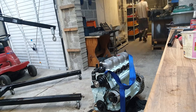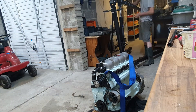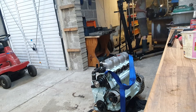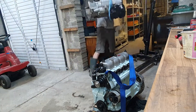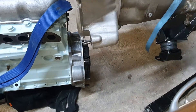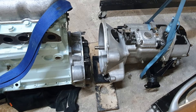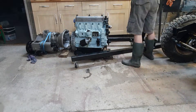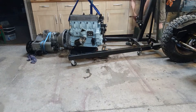The engine is now on the floor, protected on top of a cloth so as not to scratch the newly painted sump, and the gearbox comes off the bench. This is very exciting — they're finally coming together. As anyone who's done this knows, the anticipation of whether the clutch will align and the gearbox input shaft will go in — and it did in this case, which is nice. They've been apart for a while, so it just went in there beautifully, no dramas at all.